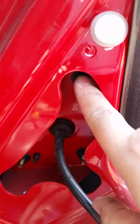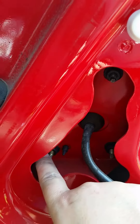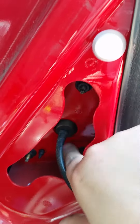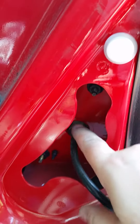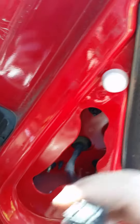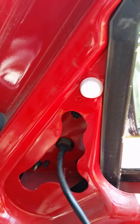There should be three screws here with nuts on them — these are 10 millimeter. You will need to remove those, and then there is a rubber plug here. You'll want to gently manipulate it so that it goes out through the hole and exits through the door. That will allow enough room to remove this plug through that hole and then take the mirror off.